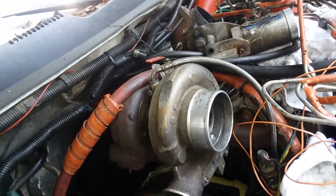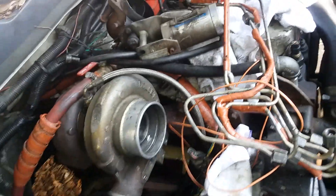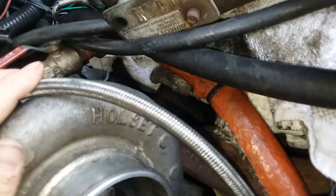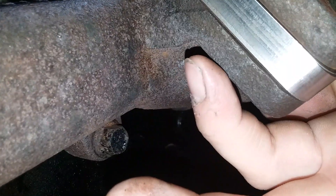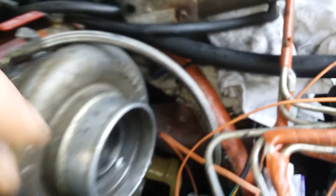This is part one of my budget compound towing twin turbo kit. This is a 12-valve with all '01 accessories bolted to it as far as the turbo. To start, take your exhaust manifold - this is actually off the 12-valve - flip it. You basically have the manifold here with the 45-degree outlet facing upward instead of going down. That way you don't have to go buy a brand new manifold for $600.